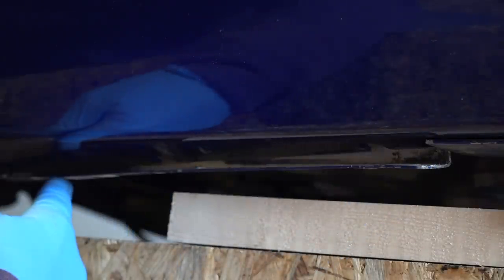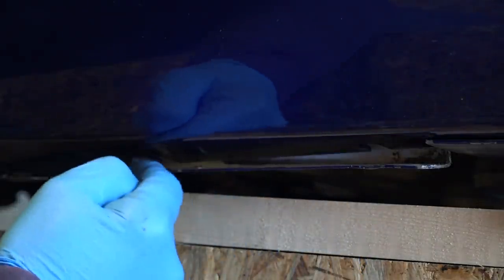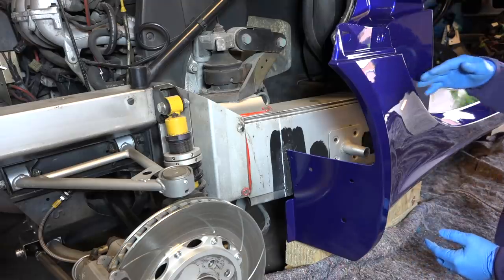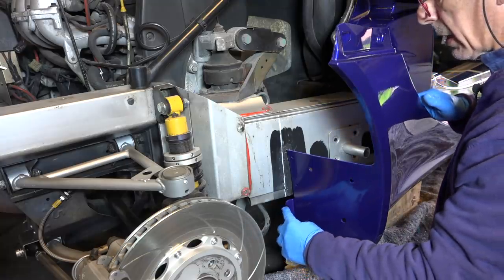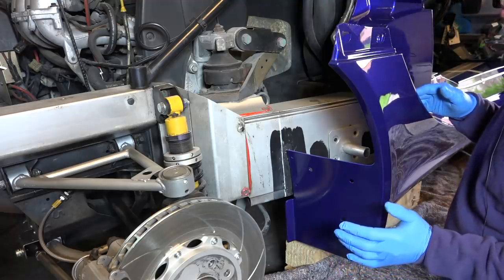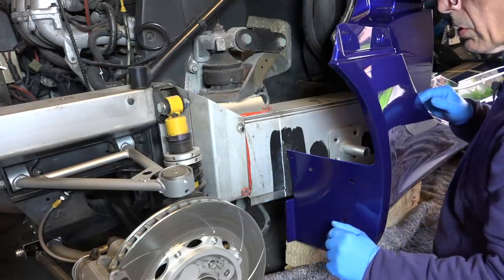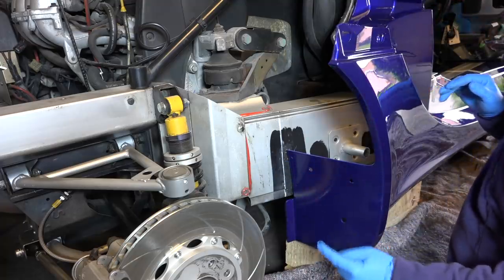In the back there's an aluminum plate covering the gas tank with holes that have to align up with the holes in the actual sill — on the sill you have to put a metal clip. The aluminum part has to come above the new sill. This is the back area where the crash cushion normally goes. But looking closely, you can see a lip here that can't be attached to anything — there is no metal behind it. I think that's a mistake from Lotus when they made the mold for these sills. This is an original Lotus sill, by the way. The only way I can hold the sill in place is over on the aluminum, and the holes there are where we need to make a metal bracket right in that corner.